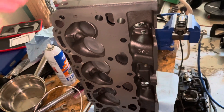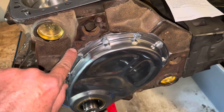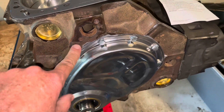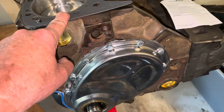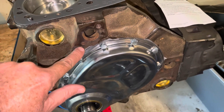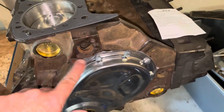If you have the older-style small block heads, you don't have to worry about it because the bypass hole is already in the head. But with Vortex heads, the bypass passage is sealed off. You can use a water pump that comes down only partway, because that hole is a dead end — it hits the Vortex head and stops. I'd still recommend plugging it with some silicone just to keep bugs out, but functionally it's not a problem with Vortex heads.